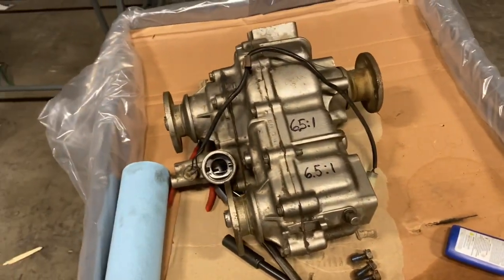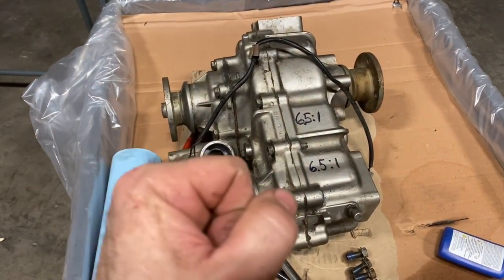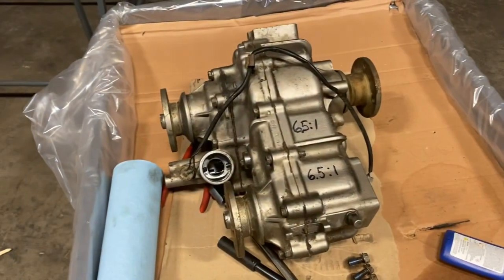The other rod controls two-wheel drive and four-wheel drive — it separates the two. Normally with the regular shifter it goes two-high to four-wheel drive high, then into neutral, then into four low. In Alaska, a lot of the trails we ride aren't very technical, so I like to be in two-wheel drive low — I like the turning radius of not having the front end locked up, but I do appreciate a good low gear and being able to creep around the trails. I want the ability to put it in two-wheel drive low gear, and instead of having to get out and lock and unlock the hubs, I can just from the cab throw it into four-wheel drive or two-wheel drive and keep it in low gear all the time.